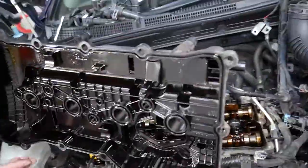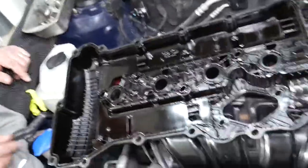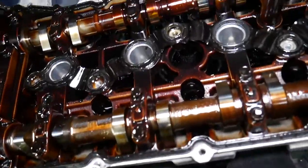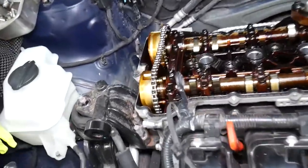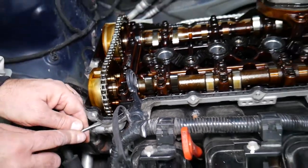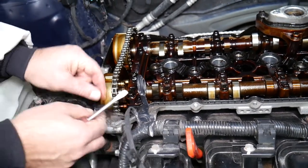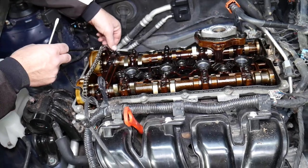The valve cover comes out. There are multiple gaskets — one stuck on the cylinder head, one for the fuel pump, and one for the ignition coil. The ignition coil gasket comes out together with the main gasket. If that ignition coil gasket is broken or leaking, oil will fill your spark plug wells, which can cause quite a bit of trouble.